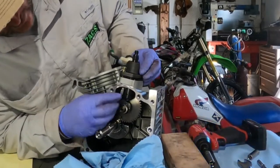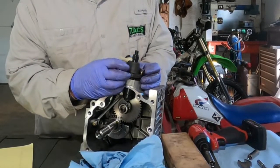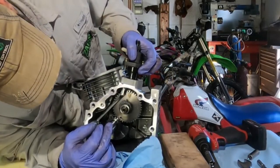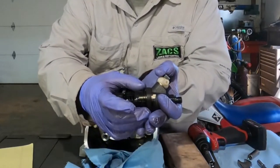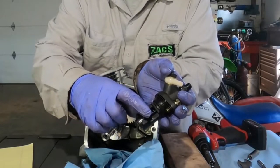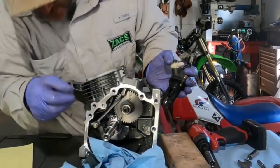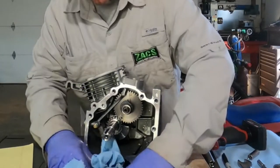What that does is it's riding on a lobe down here for your pump — it kind of rides like a camshaft. Now one thing you want to watch for: there are multiple gaskets right here, and that is for your timing. You can see the different gaskets — this one's got two on them, and they're actually two different thicknesses. Later, whenever I go through the assembly, I'm going to measure those. This determines the amount of fuel flow allowed to be pumped depending on where your governor lever is, which is right here. That activates that pin; there's a fork that activates that.